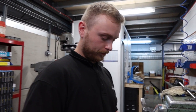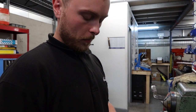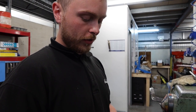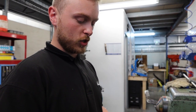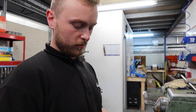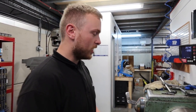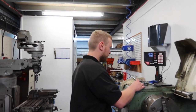So they go in the suspension arms through the middle of the polybush, and I'm guessing the fact they're too long, they just wouldn't fit in the brackets on the underside. Yeah, we've only got 36.5mm gap between the brackets, and these were measuring 42.8, 42.7, and 42.9. Oh, how bizarre. So luckily we can turn them all down and get them fitted in. Right, everyone else is next door so I'm going to head there and see what they're all up to.